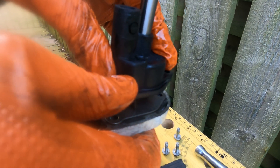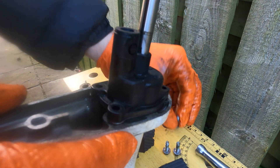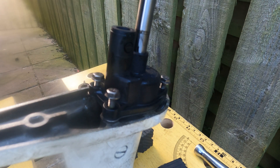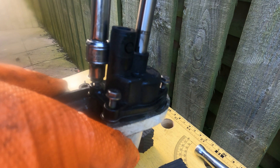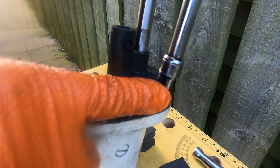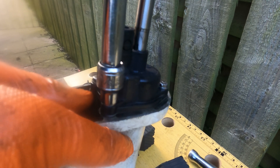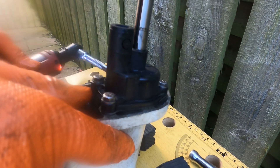Now it's just a case of reinstalling the top cover and the three bolts. Take the top cover and press it straight over the top — give the drive shaft a bit of a turn. Then put each bolt in. There's only three of them. Go back to the ratchet — that's 5/16ths. Whip these down one at a time. It's a plastic housing and these bolts are small, so you don't have to go mad. Just finish off each one to feel how tight they are and that's fine.